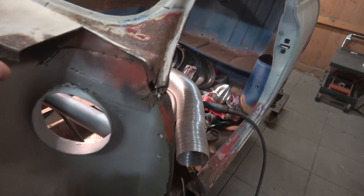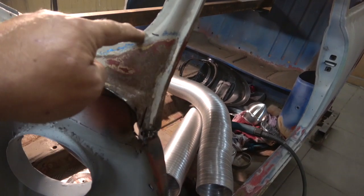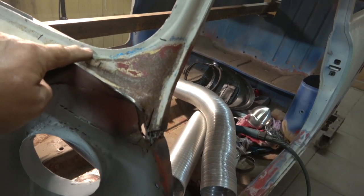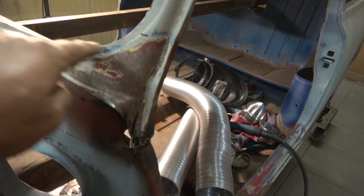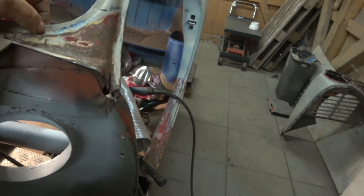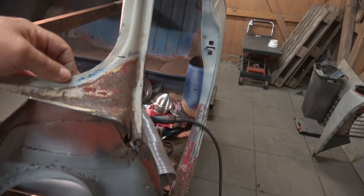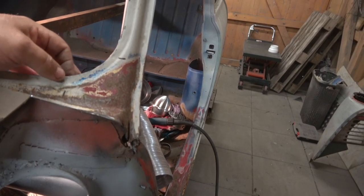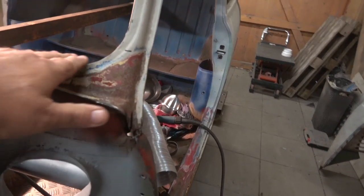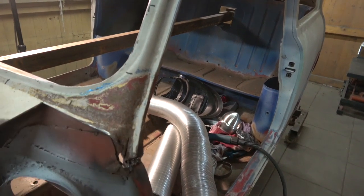What I'm really waiting for is the repair panels so I can cut this all out up to around here and take these spot welds out. Just a little tip: if you're doing anything on any of the window openings, just make sure it's well spotted and flat because you'll have trouble getting the rubber on otherwise. And make sure the aperture is spot on for the window glass.